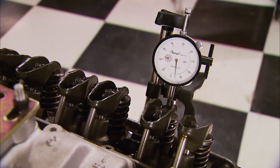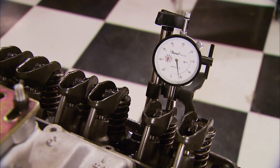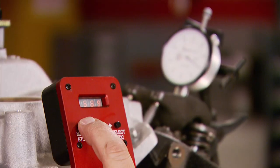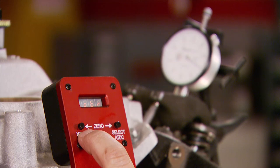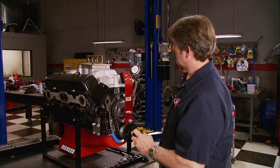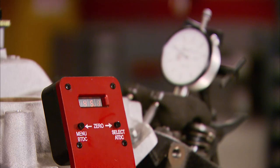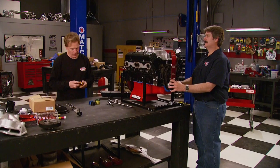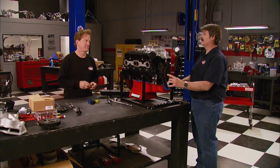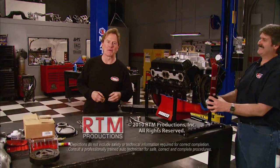To degree in the cam, rotate the engine to find max lift on the intake valve, then zero your dial indicator. If the needle starts falling, it's because your hydraulic lifter is bleeding down — it will stop in a few seconds. Rotate the engine counterclockwise to 100 thousandths before max lift, press the menu button until CCTR is displayed, press select, and the display prompts you to rotate to 50 thousandths before max lift. Press the BTDC button, and the display will prompt you to rotate clockwise until 50 thousandths after max lift. Press the ATDC button and the display shows you the cam intake centerline. As a guy who's now degreed cams the traditional way and the digital way, the DigiCam would come in really handy if the engine was still in the car. This thing goes for about $300, and the inserts are sold separately.